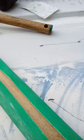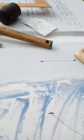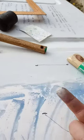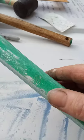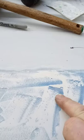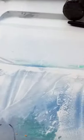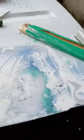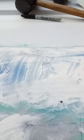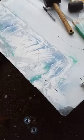So what happens is the blue paint gets knocked off with the sandpaper where the filler is too high between these two points. Then any little ridges or low points, the paint stays in them. So when I go back to put more body filler on, I only have to apply it to the bits where I can see the blue paint. Now, there's a name for this. It's called a guide coat. There are thousands of videos on YouTube on how to use guide coats. This is just your Uncle Dog, Mr. Z guy's attempts at it.